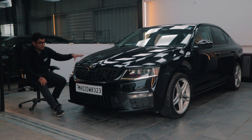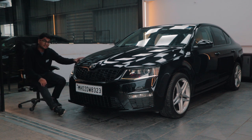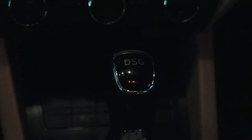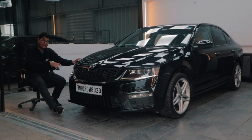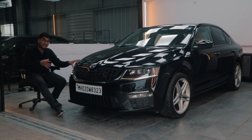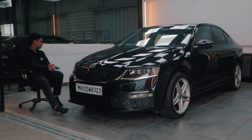Apart from that, the main problem with the Octavia 1.8 is that it comes with the DQ200 transmission. This transmission is pretty notorious for mechatronic and DSG failures. But we've kind of solved that problem to an extent with the Kevlar race clutch that this thing has. So when we're pushing big amounts of power, this thing will not fail. That is another very essential upgrade that the DQ200 needs if you want to actually do a build with it.